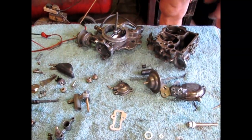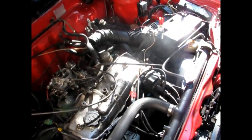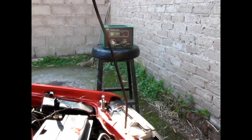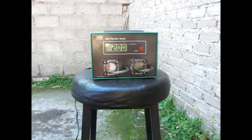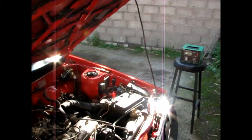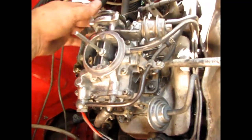I'm going to assemble this carburetor, put it on the vehicle, and show you the CO readings on the gas analyzer. The readings are showing idle at 2.70–2.80% — they'll be on 3%, your main CO reading. Leaning down to 3,000 revs: 1 to 2%. Now reading 1.20% — that's perfect. Remember, it had a flat spot. The spray jet was locked. This thing up here is only to rev it up, but now it's fine.